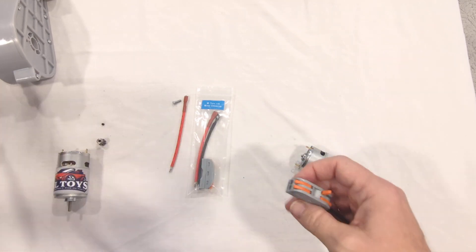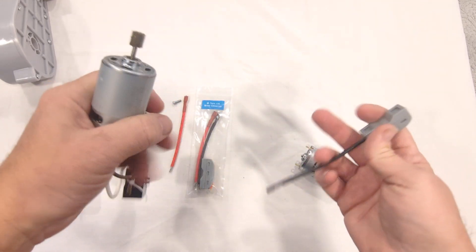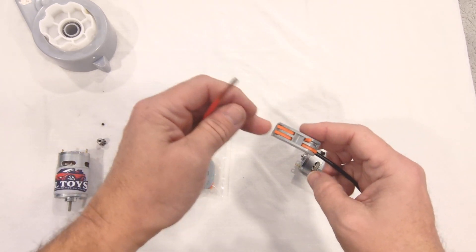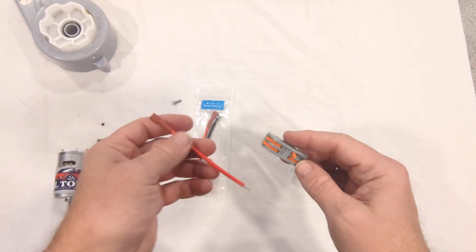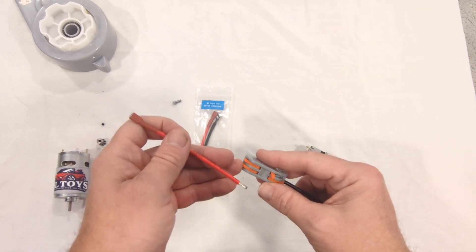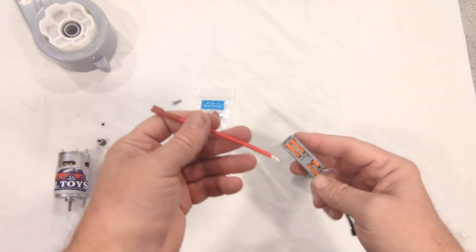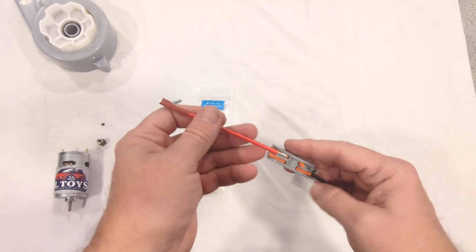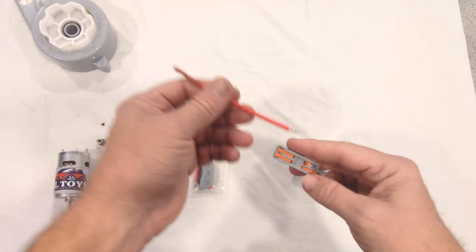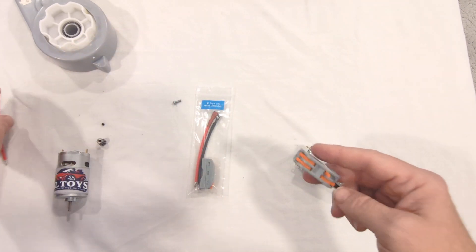On the vehicle, you've got a white connector that meshes with the original connector. Just cut that connector off, strip back about a quarter inch of wire as you see here, and you'll pop that in the other end matching black to black and red to red. Some vehicles have a white and a brown wire — the white is always going to be the positive. If you get it wrong, you're not going to blow anything up. It's just that one tire is going to go forwards and the other one's going to go backwards. So you just switch the two wires around until you get both sides going forwards when the car is in forward gear.